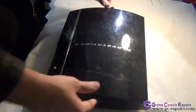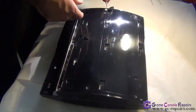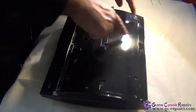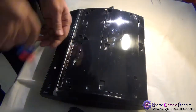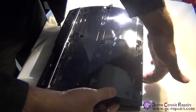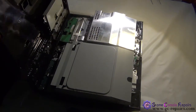We are now able to slide out our top cover. Next, remove the clip. Then remove all the Phillips screws — one, two, three, four, five, six, seven — and then there are two screws holding the power supply, so take all these screws off. Once all these screws have been removed, lift up the top cover. There's a clip here — simply grab your Microturn precision screwdriver and unclip it. Be very careful as there is one ribbon cable connected — that's the memory card unit cable. Disconnect it and remove it, and our top cover is separated.